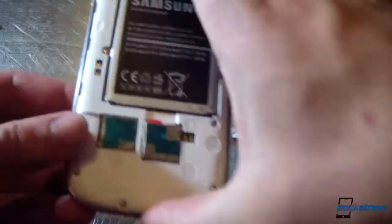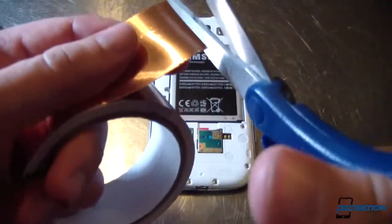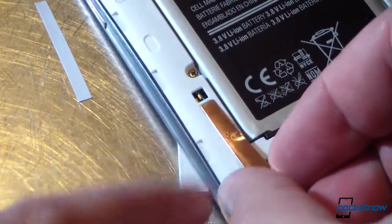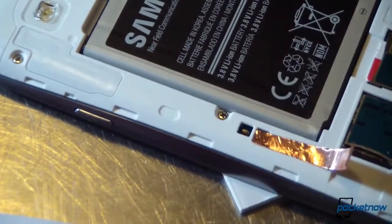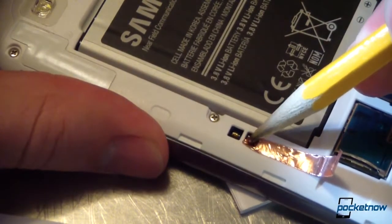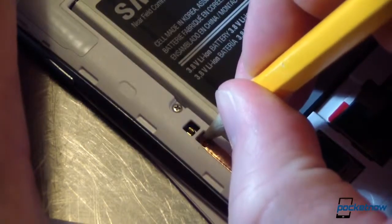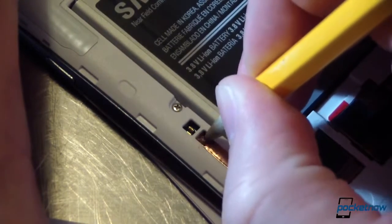Now's a good time to line up our components so we can keep an eye on the big picture. We're trying to get the charging terminals on the phone to connect to the terminals on our Palm ribbon. To do that, we need to use our copper tape. We'll cut the copper tape into manageable lengths, ranging from about an eighth to a half inch in width, so we can create two big landing zones on the phone — one for positive, one for negative. Obviously, we'll take care that the two zones don't touch. To get a good contact on the phone's connectors, we'll use a blunt object to tamp the tape firmly down on them. Careful, though — they're fragile. If you have trouble later with connectivity, you might want to try putting the tape in copper side down, as the adhesive side may not be as conductive. We had to try several times before we got a firm connection.